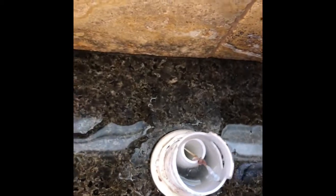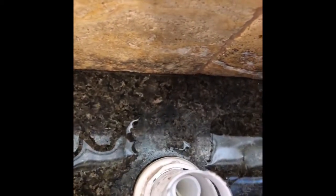If your Bosch won't drain, this air gap is the first thing I would check, because very commonly junk gets caught in it and then the dishwasher can't drain — and if it can't drain, it'll just stop. I've got this little brush and I'm going to push it into the outer chamber. This one goes into the big black pipe that leads down to the garbage disposer. We're going to clear that out — even an old straightened coat hanger would work really well.